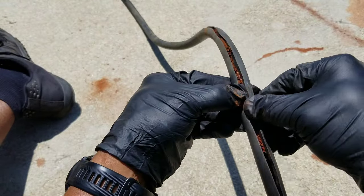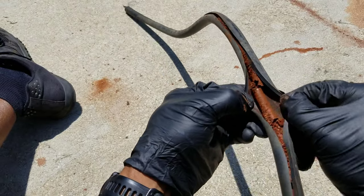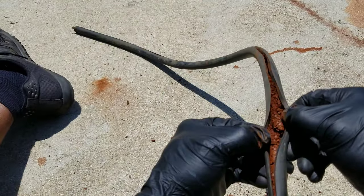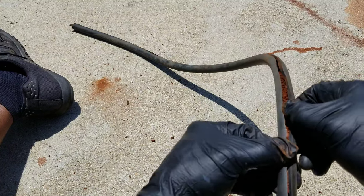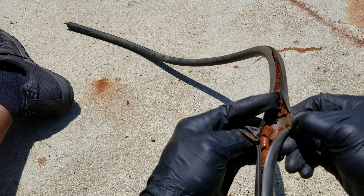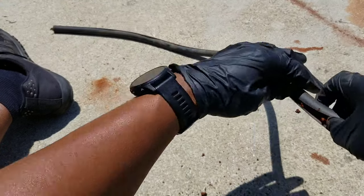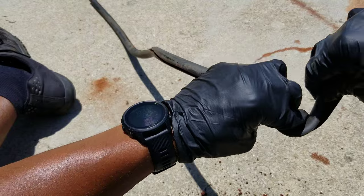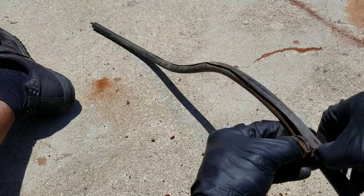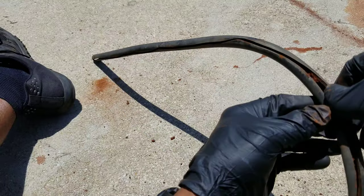So, I'm gonna ask some more questions about the history of this truck, because I'm surprised it ran as well as it did. If you'd seen one of my previous videos and paid close attention, you would notice that I had trouble with fluid going back and forth between the overflow and the radiator. And this is why. I thought there was a leak somewhere, but no, there was a blockage. I have since learned that this is common with Dexcool if it sits for a long time, but I've also heard that it happens if you mix it with other coolants.